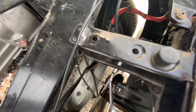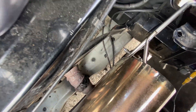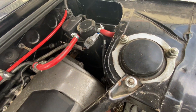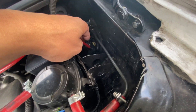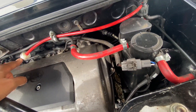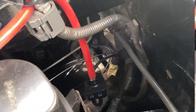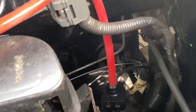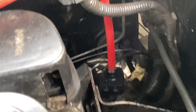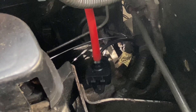It just sits there normally - I have it with a tie grip or something - and then it goes down there and then it goes in there. That's how I set it up. Then the other wideband, the normal one, goes here, and I don't need it anymore later. You can see my boost sitting here in the center, then wires, the filter, and that cable goes through there. The reason is because the oil temp isn't really the longest one - I didn't want to extend those cables, so I decided to put them through there, and it actually works very very well.